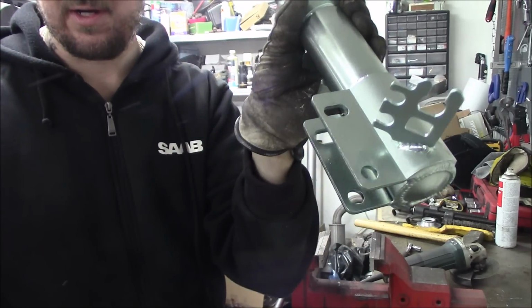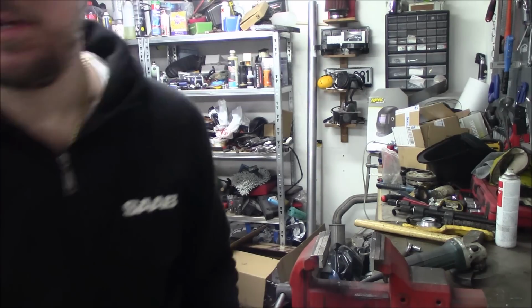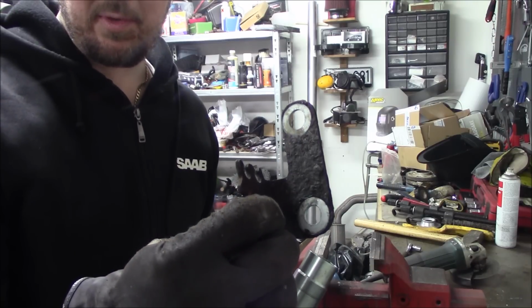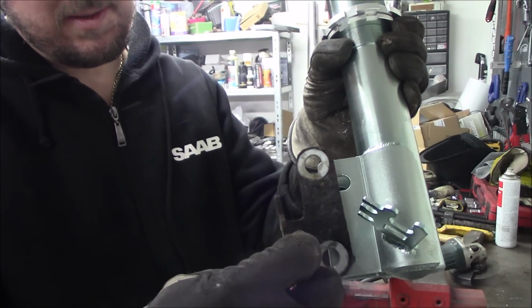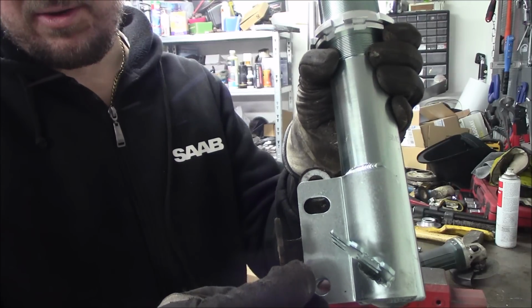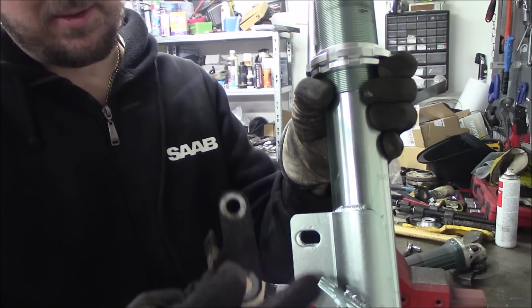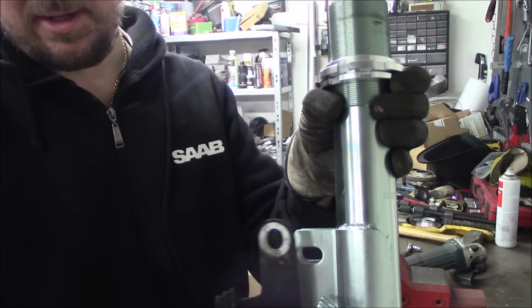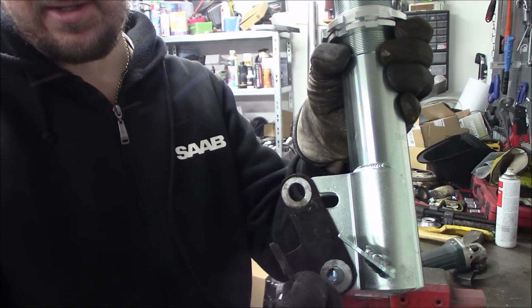It's the holder for the ABS sensor line and the brake line, and we are just going to reuse this. So here you can see the bolt pattern, and this is the new one, and you can see that it's almost out of angle. So we are going to cut this open, then weld on a little plate here. And this is also important because here you can choose whether you like to have negative camber or positive camber.